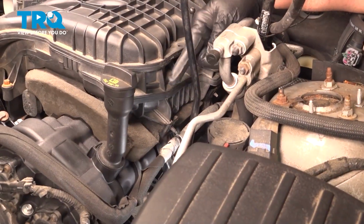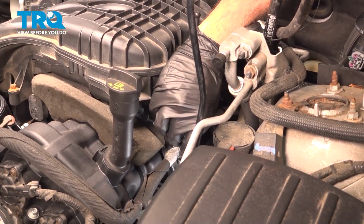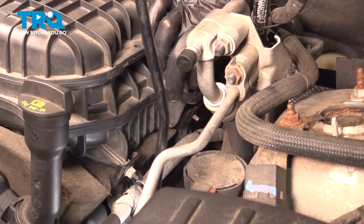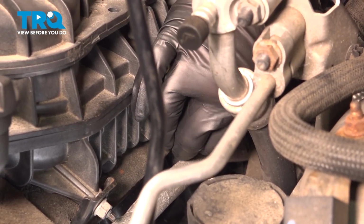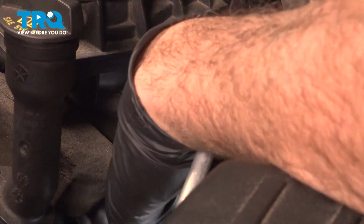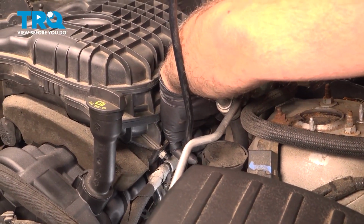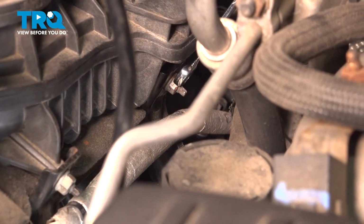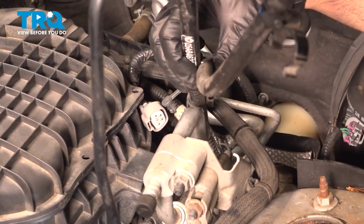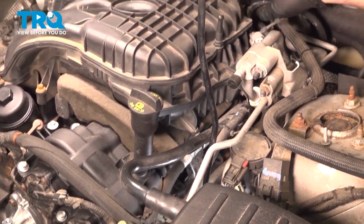and connectors. Now on the upper intake, we have these 2 brackets, and we're going to install the nuts on these here. Get that one installed. Get one on the rear bracket. Using our 10 millimeter, we can go ahead and tighten that down. Just want to snug those down. I'm going to bring our vacuum hoses over. Drop those down.